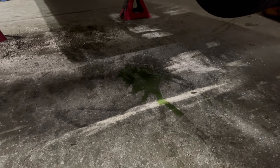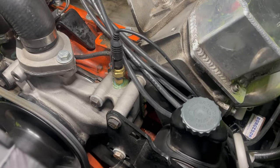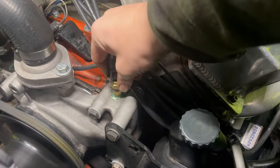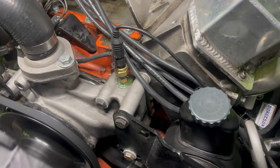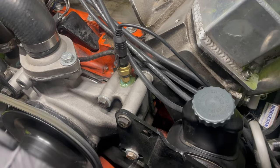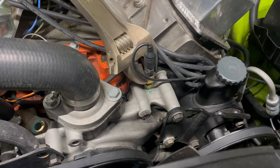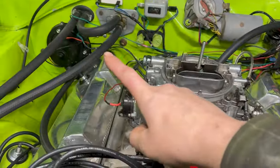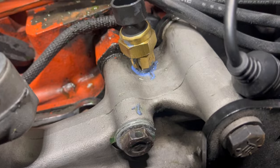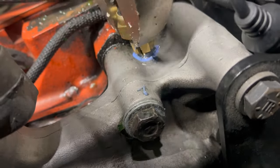Burning all that residual horror off the headers. So far so good — except I forgot it developed a new exciting coolant leak, here at this adapter for the cooling sensor for the Dakota Digital Dash. It didn't leak before, so how could it possibly leak now? I don't know why it didn't leak before. Well, I have one theory: I fixed another leak, so now there's pressure. Okay, it wasn't loose — it was very tight. That would be our issue there.